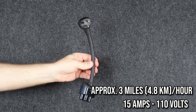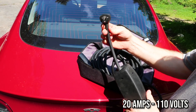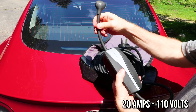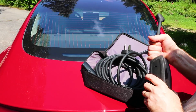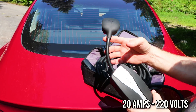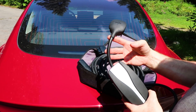We're showing you on screen now how many miles you can get when you use this outlet. The next step up is a 20-amp, 110-volt outlet — you might have it in your garage — and for that you'll need a slightly different connector. Pull this off, go to the Tesla store and buy that connector, pop it in, plug it into your wall, and that gives you this much range per hour. Next step up is a 220 outlet. Starting with a 20-amp 220 outlet, that gives you this much range per hour. Bumping up to 30 amps gives you this much range, and at 40 amps you get this much range — quite a lot of juice from your outlet.